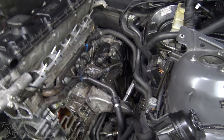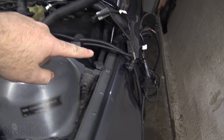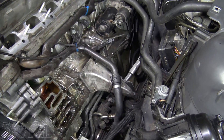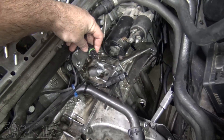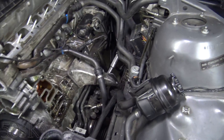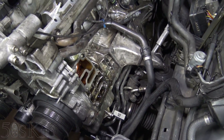I've already pulled the intake manifold off — I have a video on how to do that. Since pulling the intake manifold off, I've actually pulled out the wiring harness, so it's just draped here along the side of the car. It's really not that difficult to get out. You just unplug a couple of the harnesses, then unplug the oil level sensor, and the thing just comes right out. One of the harnesses here is for the knock sensors. I've also pulled off the oil filter housing, the thermostat, and the water pump — I have videos for all of that. Everything will be in the description.